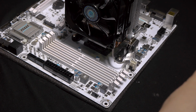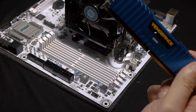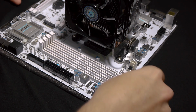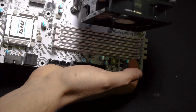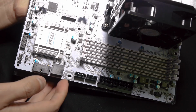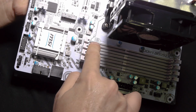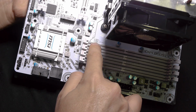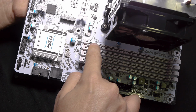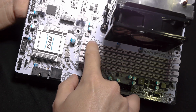I have two RAMs, I have 16 gigs of RAM, and obviously I want to exploit the dual channel. How to exploit the dual channel on those cards? Pretty obviously, actually, you can go here. I'm trying to show you guys. Over here you have an explanation about the RAM, and it says DIMM A1, DIMM A2, DIMM B1, and DIMM B2. I don't know if you can see it properly, but it's very small, so that's what it says.